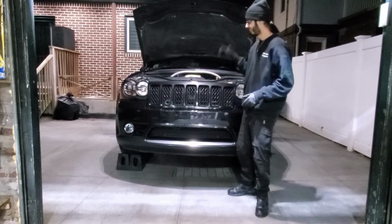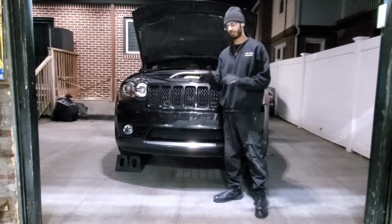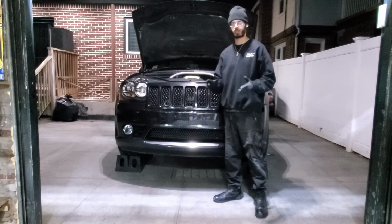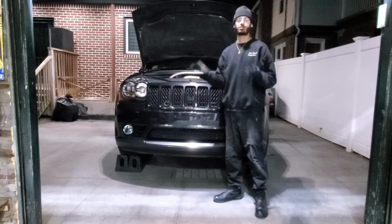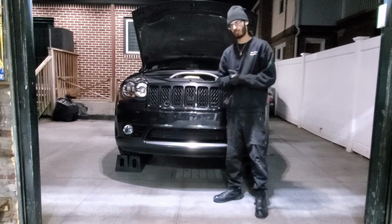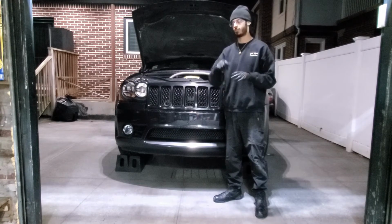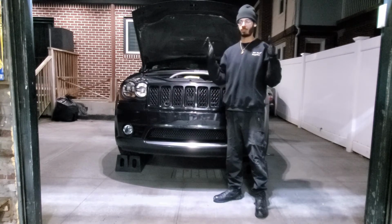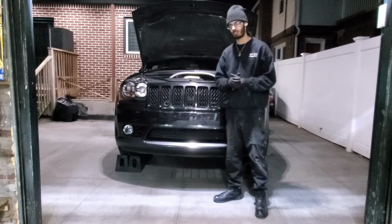So as you guys can see, we ended up putting the O2 sensors in. Now, I didn't get video of me putting them in because, like I said, I don't have clearance or room to put a camera down there where I'm working, and I didn't want to put my hands in the way and block the whole view. So obviously for that reason, I did not put a camera down there to film it, but you guys saw that I did remove the sensors, so I ended up putting them on, threw in some extra anti-seize on them just to make sure we don't have any rust issues. They were very difficult to come out because I had to use a whole lot of heat to take them out, because whatever doofus or idiot put them in forgot to put anti-seize and it gave me a hard time. So I ended up putting some extra anti-seize, doesn't hurt.